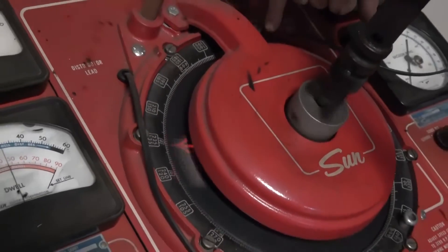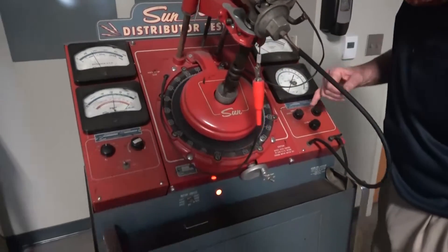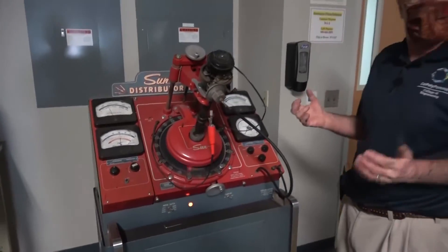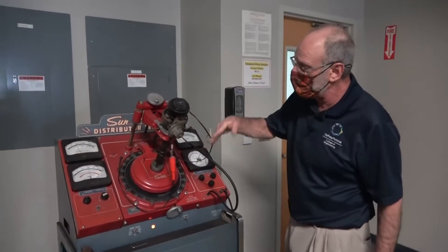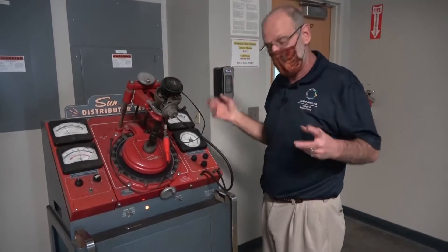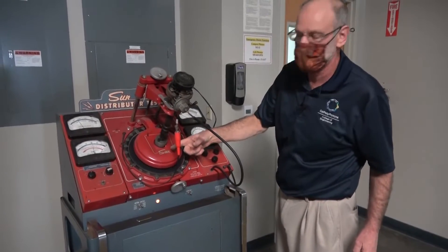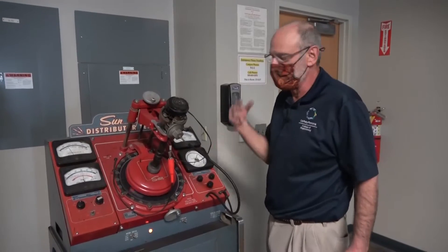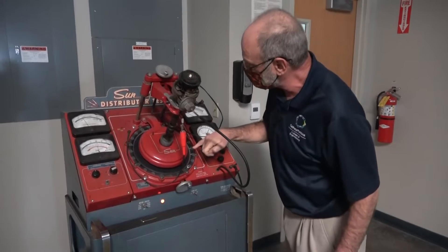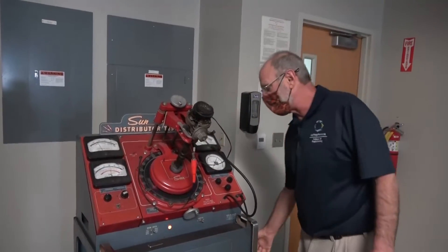Some arrows will be right on 225, 270, etc., and some will be off by a little bit. If the distributor is worn, they'll be off. What you want to do is simply record the number of degrees that each cylinder is firing. We're just sending a current to a little flash tube that sits underneath this housing, rather than actually sending current to a particular cylinder. That's how this device works — that's the first part of the test, to make sure the cam lobe is accurate.